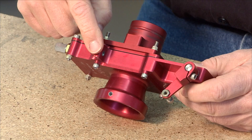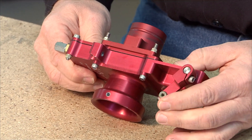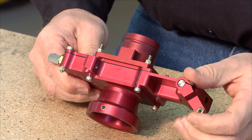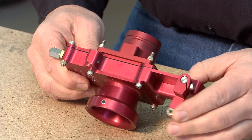Your mixture cable will come in through this bracket to secure the sheath, and then the cable will come down and attach to this arm. Mixture is off when the arm is pulled in, and mixture goes full rich as the arm is pushed out. Very simple system.